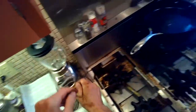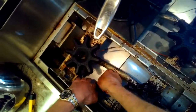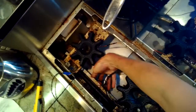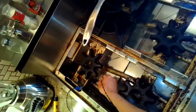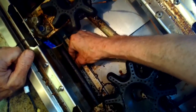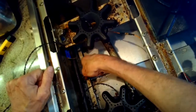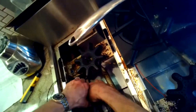There's the long wire that comes with it - they give you a lot of extra wire. I'm going to fish that wire down underneath that drawer guide, pull it on through, and then put that drawer guide back into position and put the screws back in. Now that I got that bulb in there, I just had to move the rail to the left a little bit to make it easier to access, so I'll push it back into position and put the screws back. It's kind of hard to get to these screws because there's a gas pipe in the way, so I'm just using a Phillips head and a little ratchet.